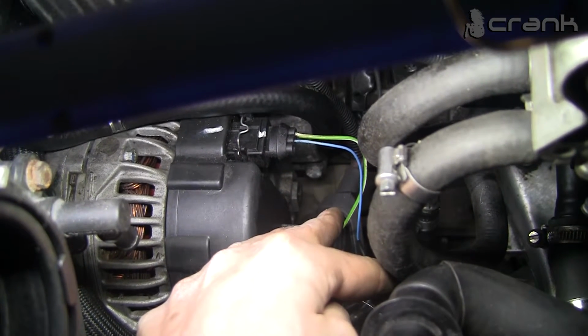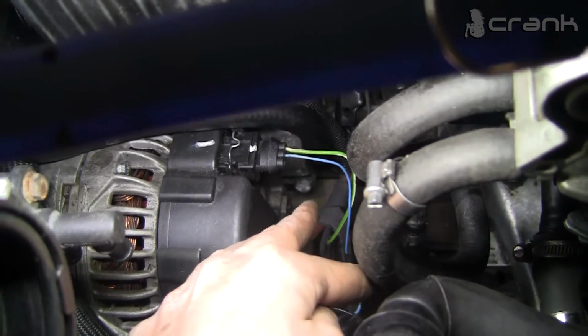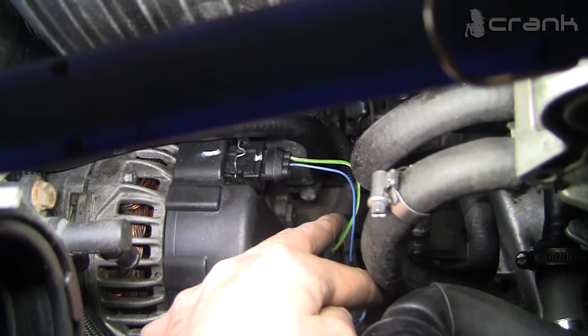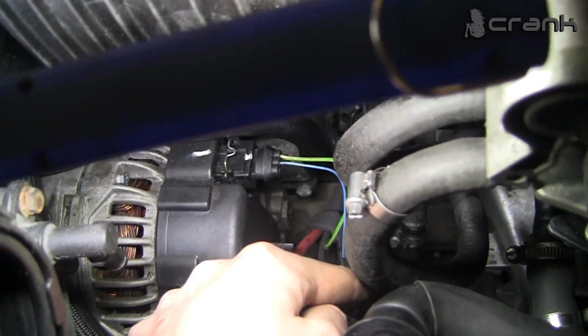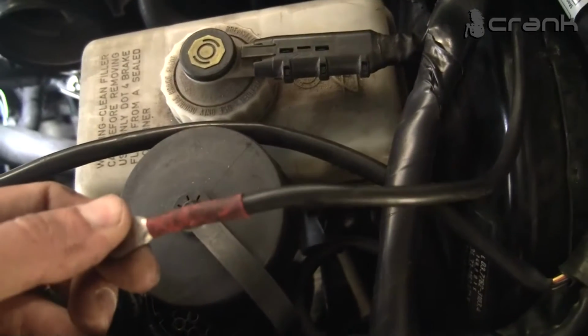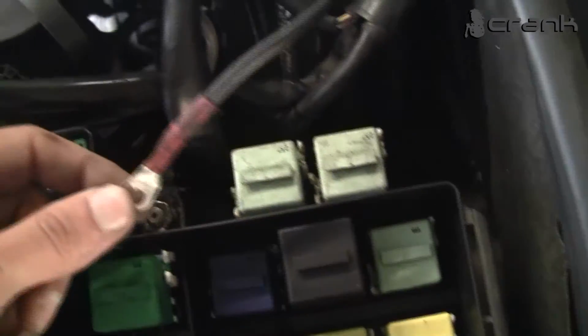or maybe I think it goes to the 12-volt supply after ignition. I think it was that. But we just isolated it. We're going to see if it works like that. I think it should. And the only thing that we're not sure where it should go is this positive wire. Maybe we're going to put it on the fuse box.